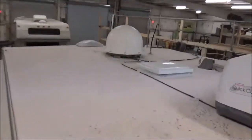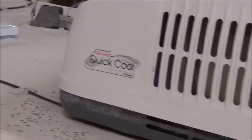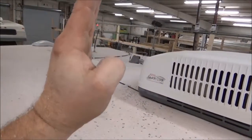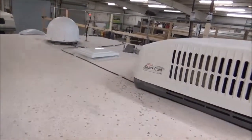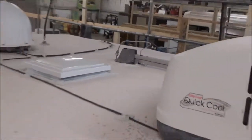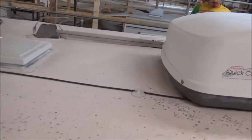We're also going to make some special boots for your satellite right there. We'll make one for the TV antenna, the radio antenna, and get it out of there. When those things stand up as you're trying to get some reception, they walk back and forth even in the slightest breeze, and it compromises the seal on the foot of the plate. So that's why we don't like those. Also, a lot of them are so old they don't really work that well. You're better off putting something like a Winegard or something else.